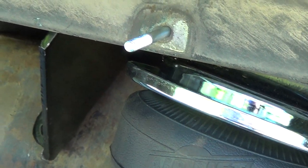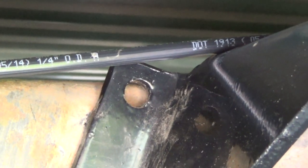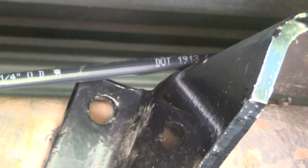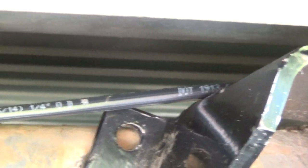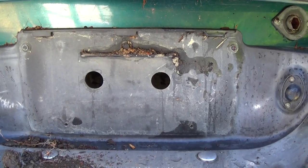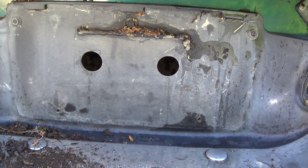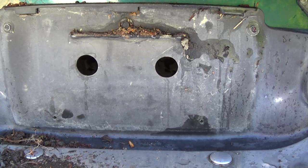The airline goes behind the bracket right there. I had to get it in blind using just my fingers to feel the fitting and then force the hose into it. Then I routed it along the frame — being careful because the muffler is right there, so you've got to keep the airline away from the muffler. I snaked it to the back of the truck. I took the license plate off, enlarged the existing holes, put the air fitting end of the hose through, and used the nut that holds the air fitting to also hold the license plate on.